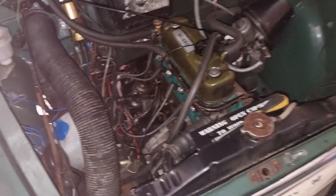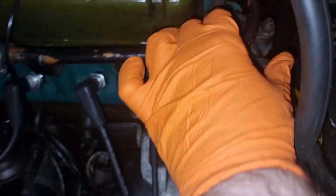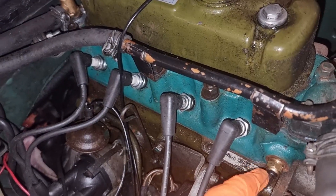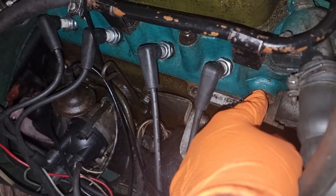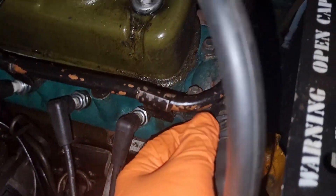Today on fixing assets, this was showing as running a bit hot. I've got a couple of things I need to do. First of all, I'm going to change the thermostat because the housing is a bit iffy. Second of all, if the thermostat is okay, I'm going to change the sender because it's either sending a very high temperature to the car quickly, or it's blocked.